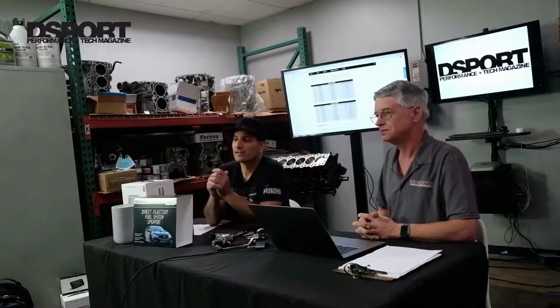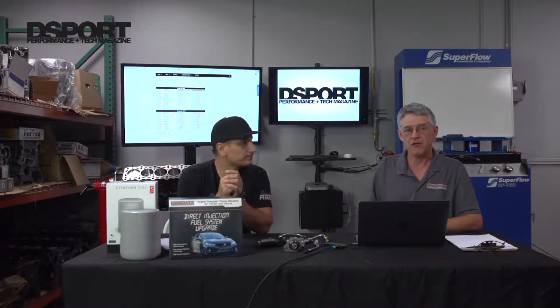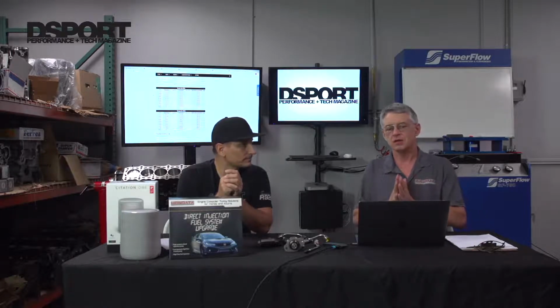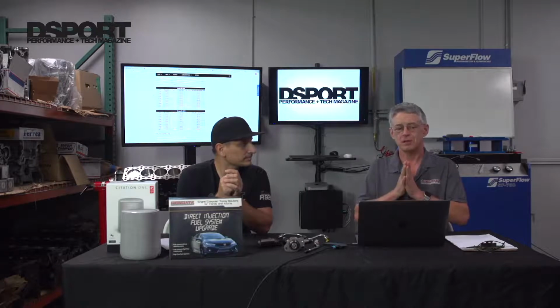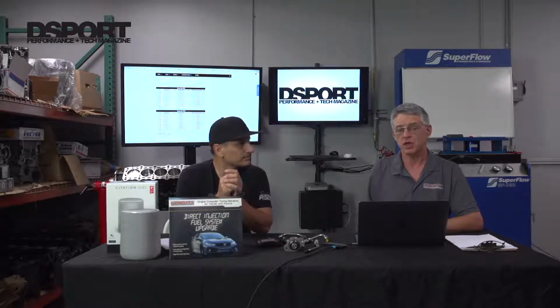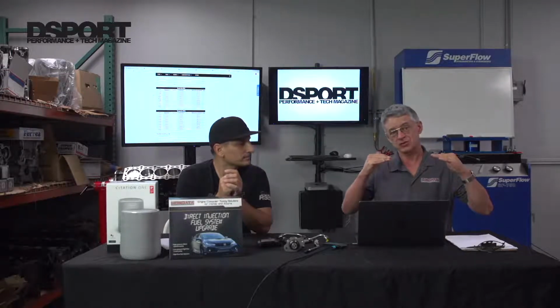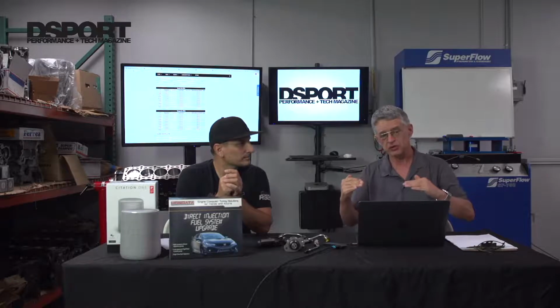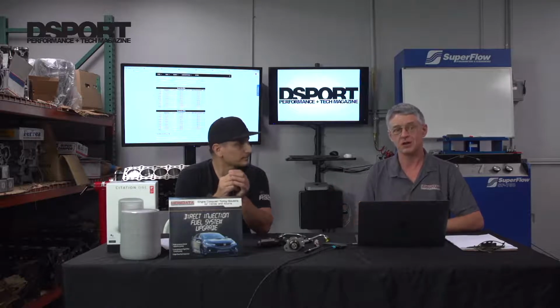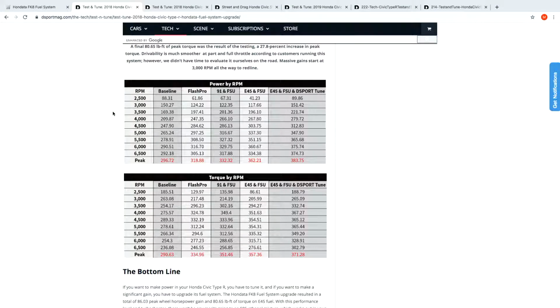We have a question out there. Can you run any level of ethanol with this? We have run up to 85% ethanol on this. However, the testing that we've done, the sweet spot for maximum power is between 40 and 50% ethanol. So that is what we recommend people to run on. You can run E85, but as you get to higher ethanol levels, we've got to reduce the boost to reduce the load on the fuel system somewhat, because you're getting right to the limit of the fuel system with E85 on the Hondata fuel system upgrade. You can do it, but your sweet spot for power and torque is E40 to E50.